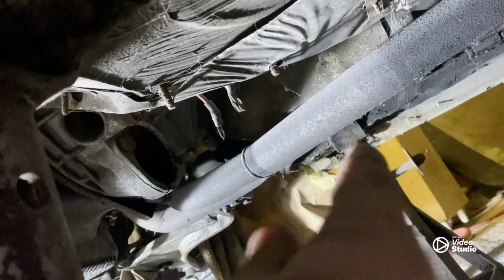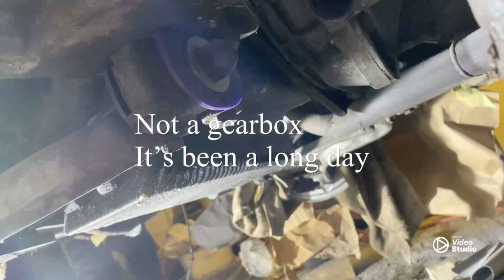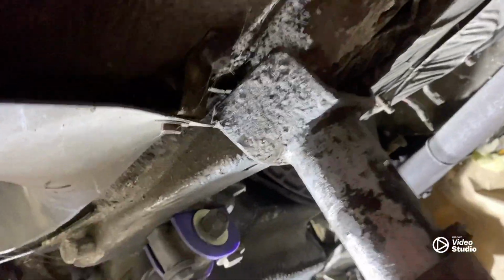Right, so that's the starter motor off. It's just right at the back of the gearbox there. I've got the tool here, the locking tool. It just obviously goes in there as and when we need it, but obviously now first of all we need to take the spark plugs out. But yeah, overall this car's very clean underneath, quite a rust free example. Even got the original jacking points on it. Now the last car I had, I had to fabricate some of them up myself.